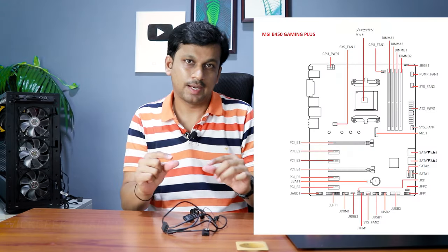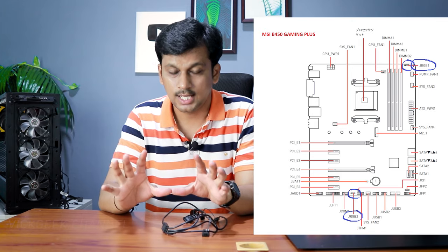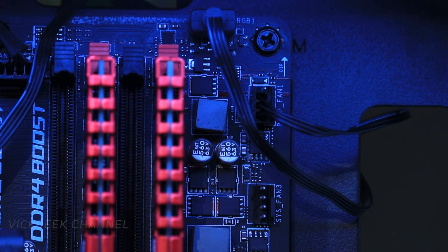Before we begin, there are a few things to note. Every motherboard manufacturer will label the slots properly - if there is an RGB or ARGB header you'll know it. If it's there, it's very easy to connect no matter what fan you've got. There will be two pins: one connects to the JRGB or RGB connector on the motherboard, and the other pin goes to a SYS FAN slot. If you find a four-pin SYS FAN slot and your pin is only three-pin, don't worry - just connect the three-pin to the four-pin slot and you can control the lighting using the PC software.